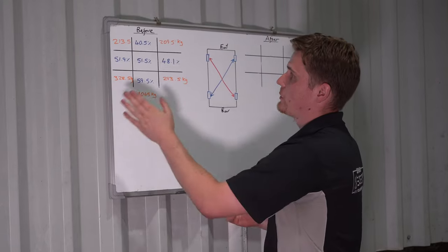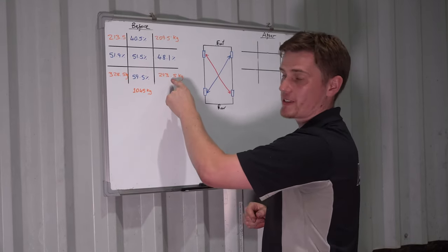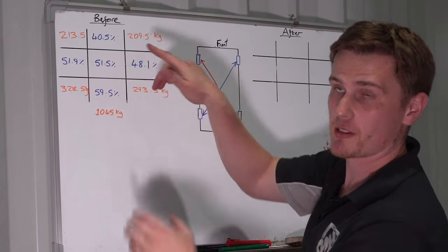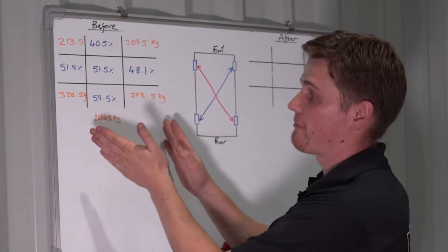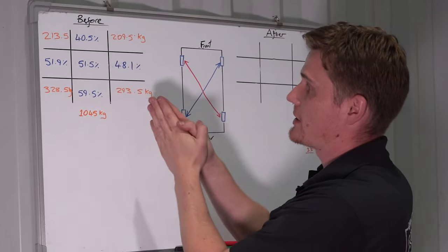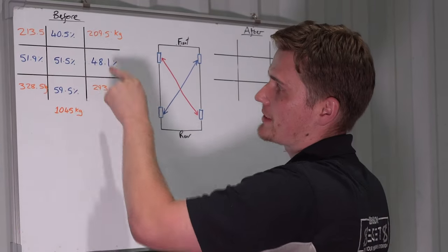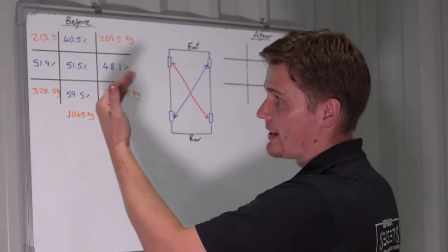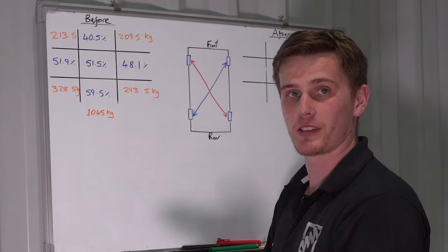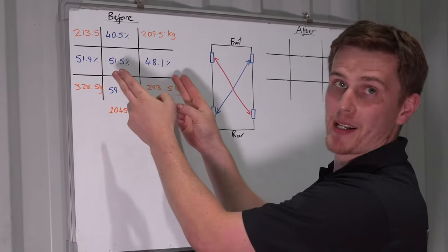With the driver in there, it's really lightweight. We've got the layout showing front-left, front-right, rear-left, and rear-right - the mass present at each wheel that makes up the total. Across the front we've got a four-kilogram difference left to right, and across the rear we've got 35 kilos difference. This is mainly because the driver sits on the left, putting a lot of mass onto the left side. We're also looking at front and rear percentages - 40.5% at the front and 59.5% at the rear. Changing those with corner weighing is difficult; what we can affect is the cross weight and the left-to-right masses.